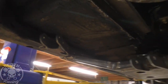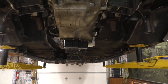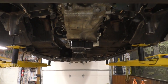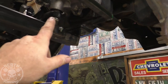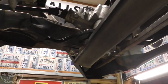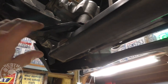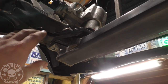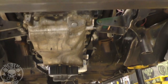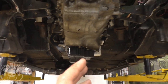Moving up front, there are some concerns with running four-link on a long-travel suspension car, especially if you're going to do it for more of a high-speed type thing. When you're doing a traditional style steering box, really the only option would be complete hydraulic steering, which is not DOT approved and I wouldn't recommend it either — if your engine stalls, you have no steering. You have to have mechanical linkage to your steering regardless. The steering cylinder does help for bump steer from things hitting the tires, so the steering cylinder is going to help prevent that — but that's not the bump steer I'm talking about.